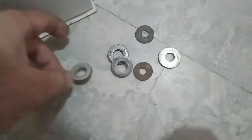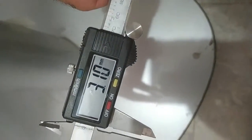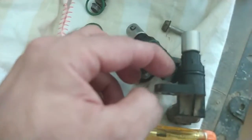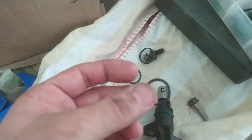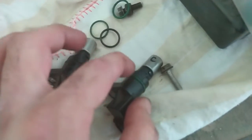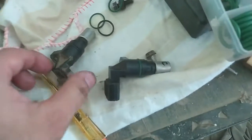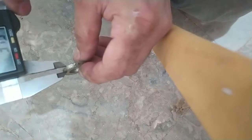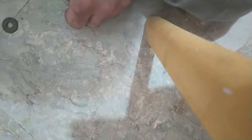The reading is 3mm. I'll make a washer that's 3mm. I also thought the O-ring was worn out, which is why the sensor was going in too far, so I replaced it with a new O-ring. Since Honda does not include any washer, I applied a new O-ring, tightened the sensor, measured the distance — it was nearly 3mm — and planned to search for a 3mm washer.